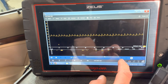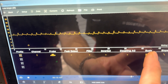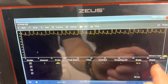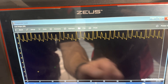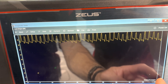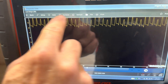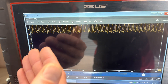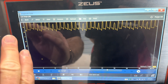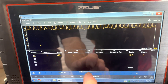We can manipulate the Zeus too. We can change from the 20 amp scale to a 10 amp scale, but it's going to go off higher on the screen. We can bring the view open a little bit but we're still off the screen because the 10 amp is up there and we're bottomed out as far as we can go down. Still, the pattern is perfectly readable — you can diagnose this car based on this pattern 100%. It's just a little more difficult to use for me.